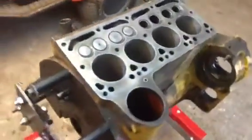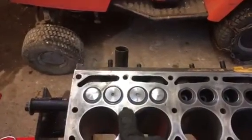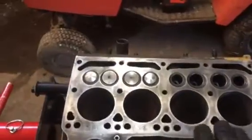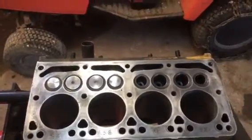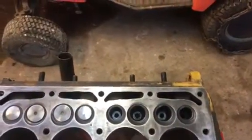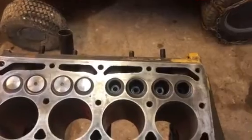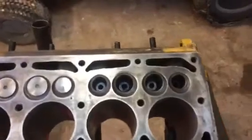I've been doing a little work here on the block. The broken head bolt that was in this hole right here I got removed. It was a little bit of a time-consuming struggle but I got it out without ruining anything else. I've got the deck cleaned off, the cylinders honed so they're all in good shape. I've got the new valve guides installed and I've also got some of the valves ground here. The valve seats were reground — they weren't too bad. The exhaust seats were a little pitted, the intakes were pretty good but I'm just touching them up with the valve grinder anyway.